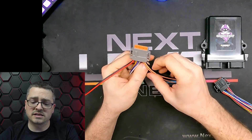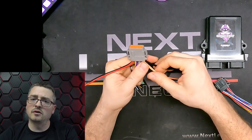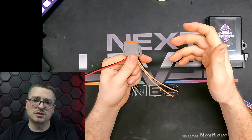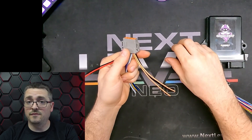We do utilize these when using an external relay or like a power saver — these can actually activate the power savers. And that way you can use these similar to how you would a 12-volt trigger on a Ghost. So you can use these like you would the 12-volt switches on a Ghost Plus to activate a relay, and our power saver can be activated with just 5 volts.